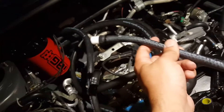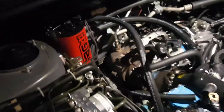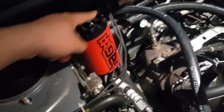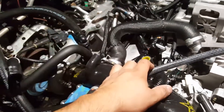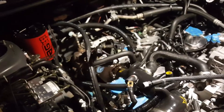Aside from that, you have some coolant connections that come in and out here — one connects to the top reservoir and there's a bottom one I'll address in a different video. These two connections go to the intake manifold: one goes directly there, and the other goes through the evap fuel fumes system and ends up on the nipple there.